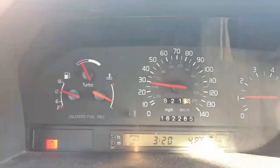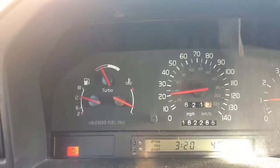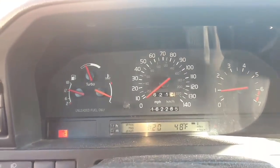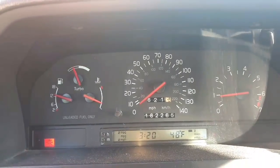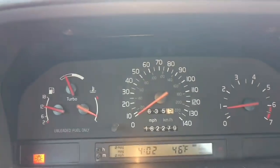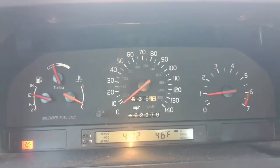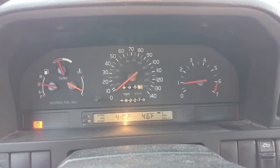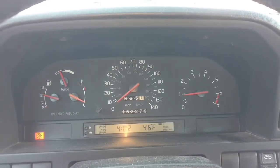It looks like this car is running cold, so I'm wondering if the thermostat is broke or stuck open. I'm going to check the temperature with my scan gauge when I get back from taking this car for a wash. The lady that has this car — you guys have seen it before — she's definitely a senior, so her car is filthy; I decided to take it and get it washed for her. This thing is dirty, needs some TLC. Somebody stepped on the brake lights for me at the car wash, and two brake lights are burned out, so we've got one left. I'm going to get some bulbs and fix that for her. The temperature did rise a little bit and then dropped back down, so that thermostat is messed up. It's that time of year, and I did good by not losing it — Diane gave it to me a week or two ago and I kept it, opened it up just in time.